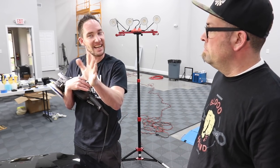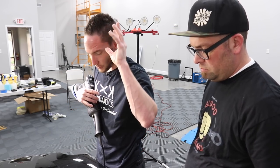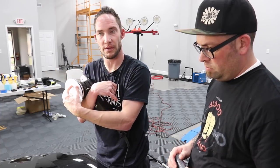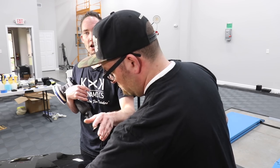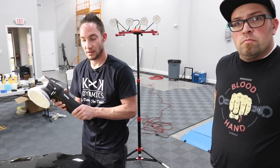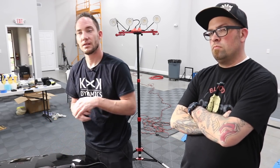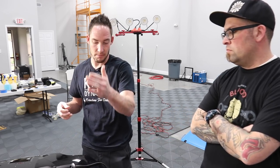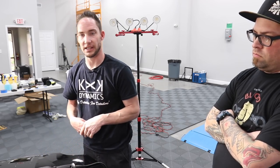So wouldn't we want a non-diminishing polish to do that type of short cycle? Again, I don't think it matters, because typically we'd never do that with a diminishing abrasive, since we never get to the longer cycle. If you never get into the longer cycle, then it doesn't matter. You're using whatever the initial bite of the compound is. I'm more focused on my technique than on my product.